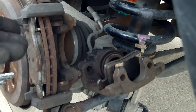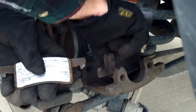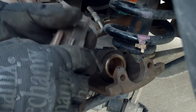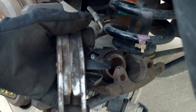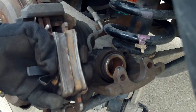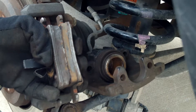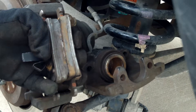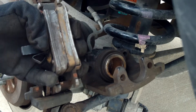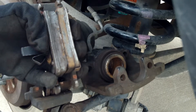As you can see, I got the clip off and the caliper off. This is the outside brake pad and this is the inside brake pad — it's got this little spring that actually goes down into the piston itself. If you're looking at those you're probably wondering why I'm replacing them, since there's plenty of brake pad material on there. I was getting a little bit of squeaking, a little bit of brake noise, but it went away since I did the front. I had already planned when I purchased this vehicle — because they're so heavy and I didn't know the last time the brakes got serviced — to go ahead and replace all the brake pads, and that's why I purchased them as a set.